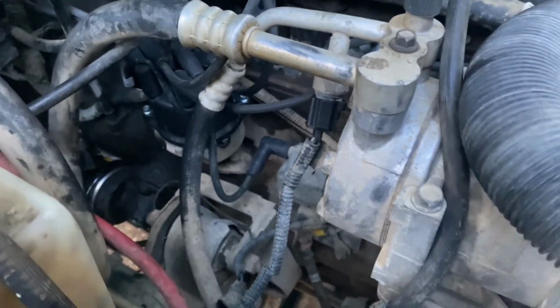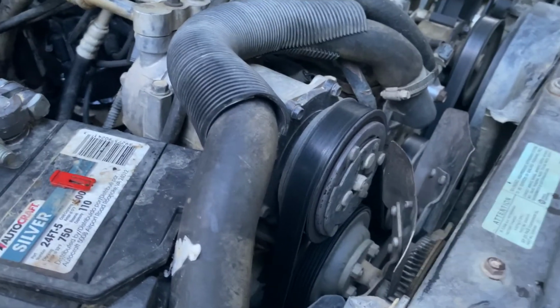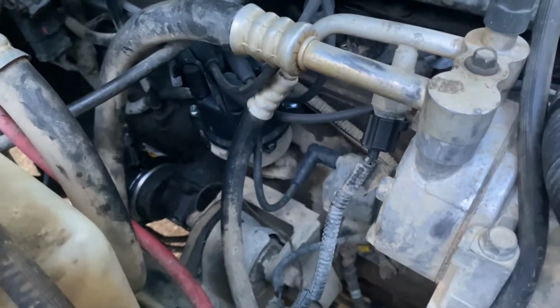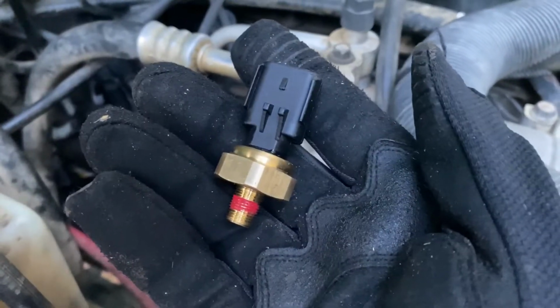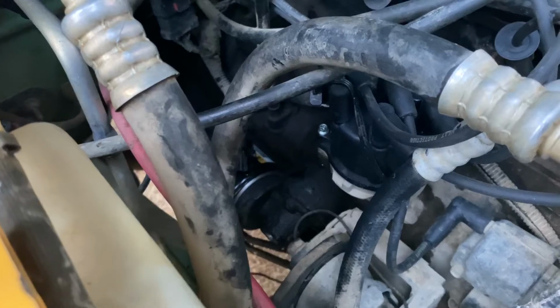Just a piece of advice: go ahead and go to AutoZone, or if you have the right size socket, which is a 1 1/16 inch socket for this, do that. Go get the socket, or use the socket, and it makes your life a whole lot easier than just trying to fool with it with a pair of channel locks. So now all we've got to do is put the new one in. I will leave a part number for this and a link in the description in case you want to pick one up. But now we just have to put that one in and plug the connector back on, and we'll be ready to go.